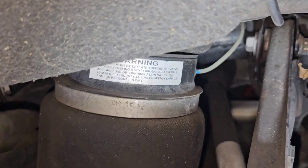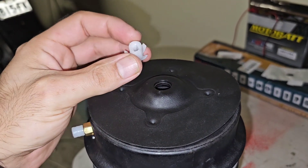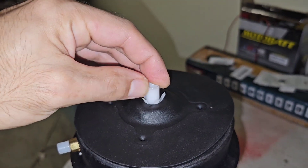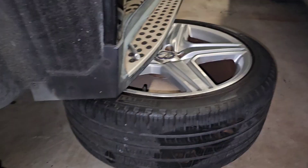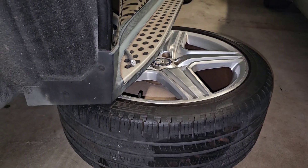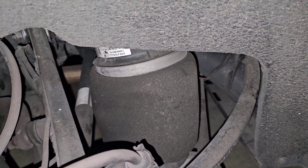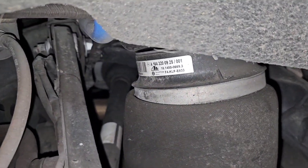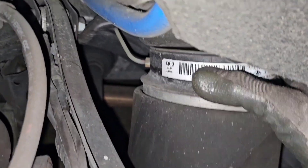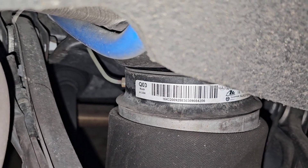The air spring should be deflated before removal, otherwise it will cause damage. The whole air spring is hanging on a little plastic clip that goes in and stays there, so when removing the original air spring just pull it out gently. You need to use a stand — a jack is not enough for this vehicle — and also put a support in case something goes wrong with the stand. Before removing the air spring, note there is a 10 millimeter fitting that you need to remove first.